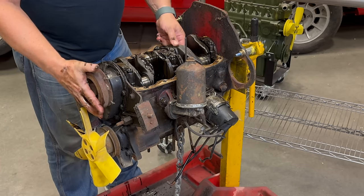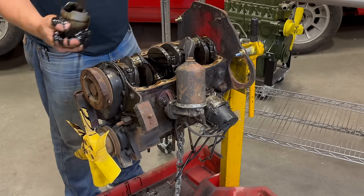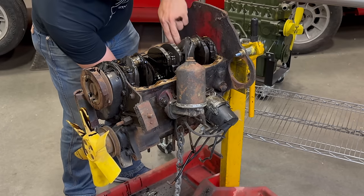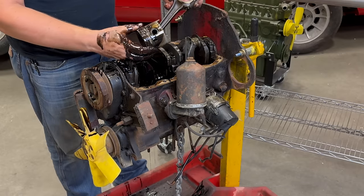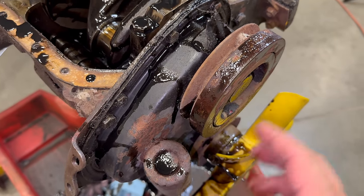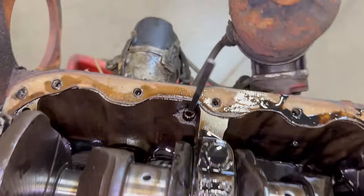Here's number two piston — the bottom two rings are free, the top two are seized up, so this engine would have smoked pretty bad if we had gotten it running. Now we can turn the crankshaft out of the way and get the other two pistons out. Number one, all the rings are free on this one. Number four, the rings are also freed up but they're very sharp. If you haven't seen this before in a real engine: as I turn the crankshaft, there are two sprockets on the end with a chain between them just like a bicycle. That chain goes down and turns the camshaft, and there's another gear here that goes out the side of the block to turn the distributor.